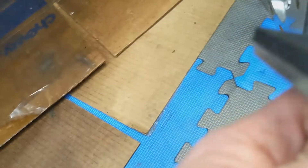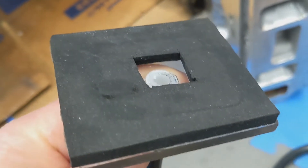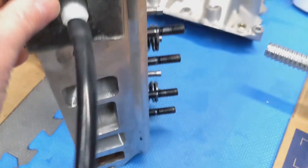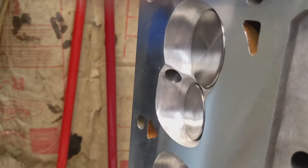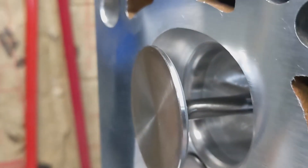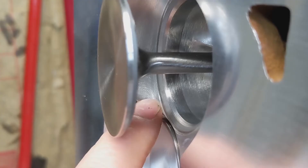I made a little plate out of some plexiglass I had, ran up to Ace Hardware, and this little fitting was two dollars. Then I ordered closed-cell foam off Amazon — you get a whole box but you just need a little sheet of it, or I'm sure you can find something at the hardware store. You hook this up, it creates a vacuum, switch your valve on and it starts pulling a vacuum, then you flip the valve and watch it hold. These all seem to seal up really nice. There's the 60, the 45, and the little top cut is the 30, which blends right into the chamber.